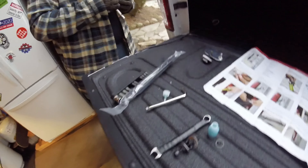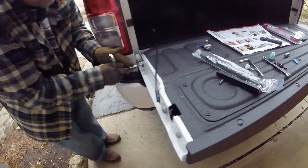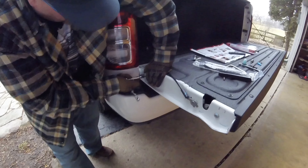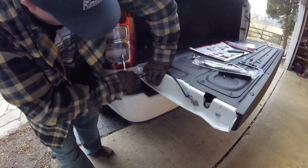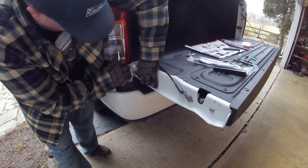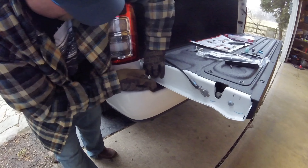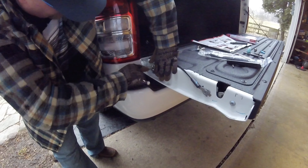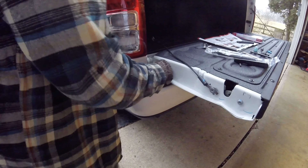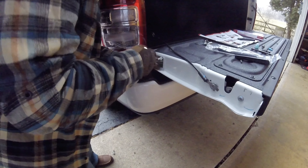Figures it wouldn't be the same size - it's a 4mm with the supplied bolt that they give you. Just want to run that down - it's got a little loctite on it. Don't bang your tail light like I just did or you'll crack it. You can see that it fits snug around the mounting point where your tailgate mounts. As long as it's flush, you are good to go. Give that a little more - that's it. So that's the bottom part done.